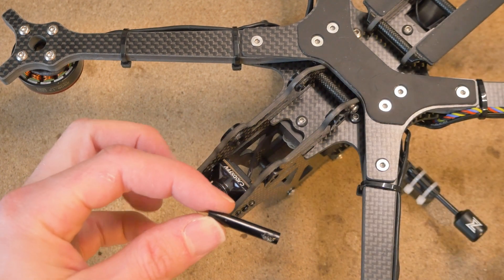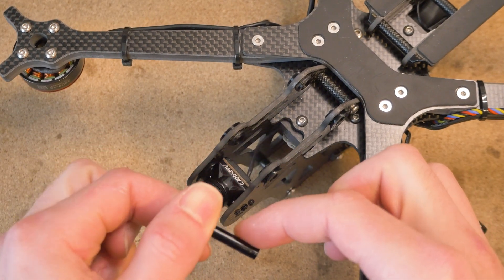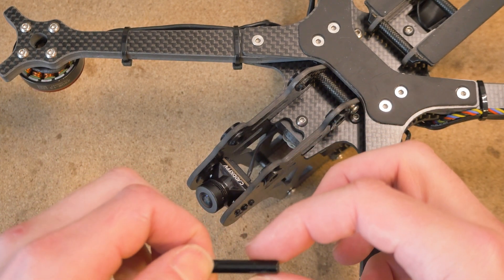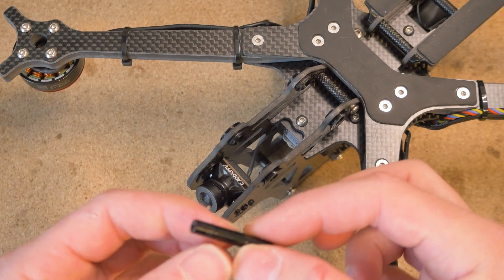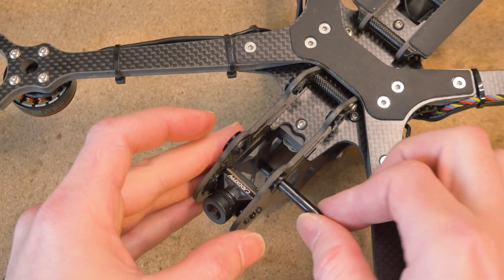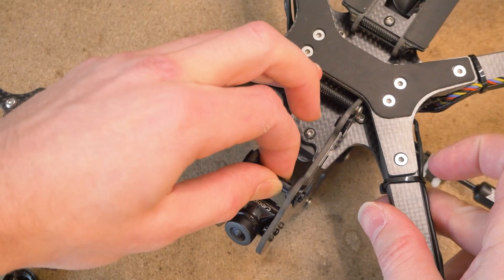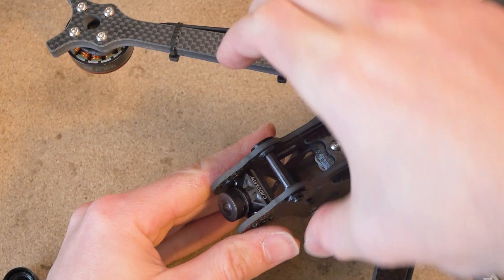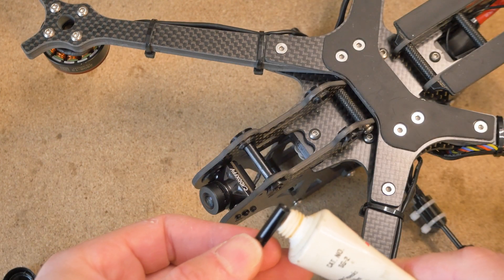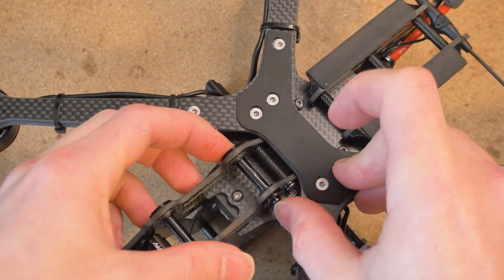What I'm putting on here is some silicone grease. Polypropylene and TPU are very chemically resistant, so you can use a whole variety of lubricating greases such as petroleum jelly, white lithium grease, or many other compatible options. After doing that, it now takes much less force to slide it back and forth, and there's still no play in the vertical direction — which would translate to rotational play if you had a camera attached. I'm going to lube up my second standoff as well.